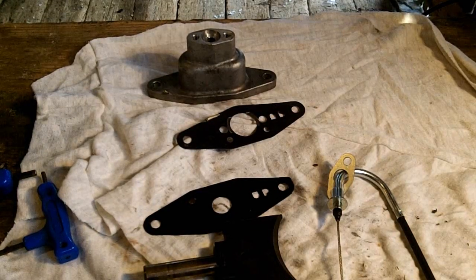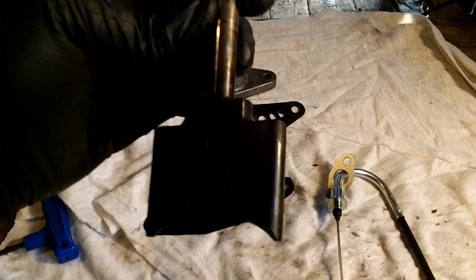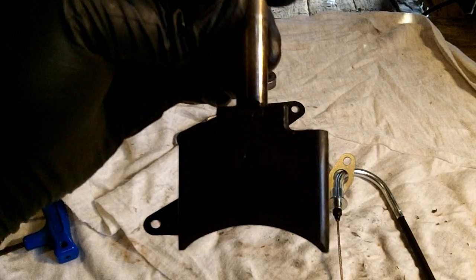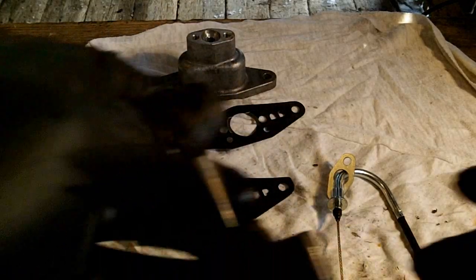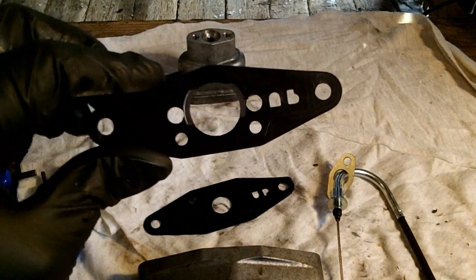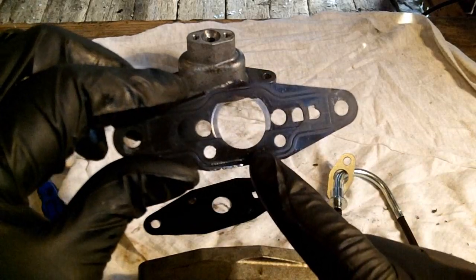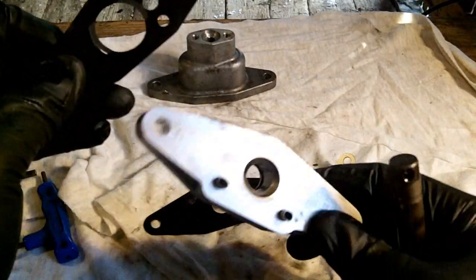I've got my pieces all cleaned up and lined up, and I'm just going to use the one that I haven't taken apart yet as a guide. So I'm going to face it the same way. So this is the guillotine, which raises the exhaust port, and I'm going to put it slot up. And it goes through the bottom gasket. The bottom gasket has the holes at the one side. And then our bottom piece.